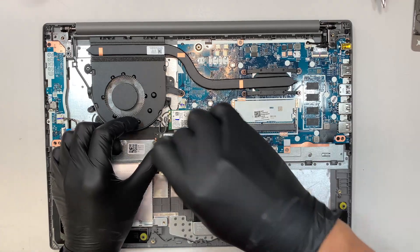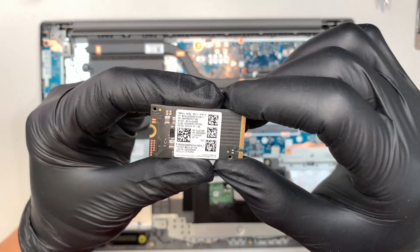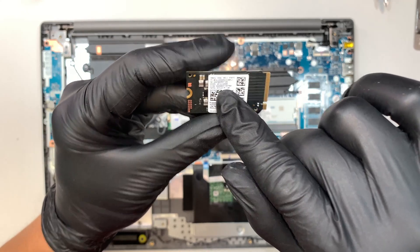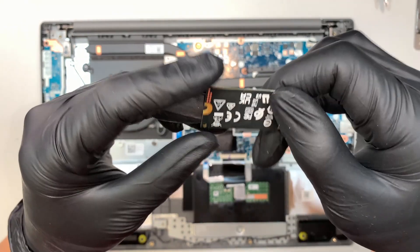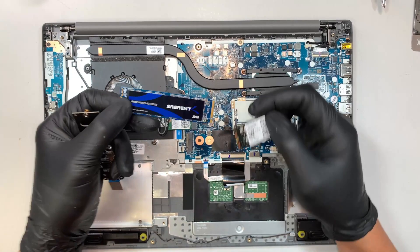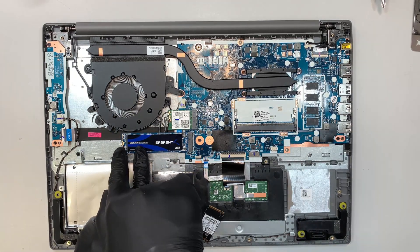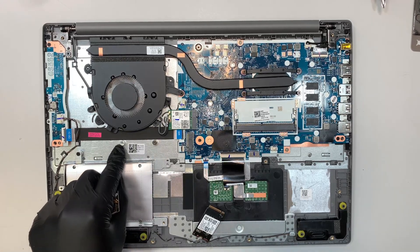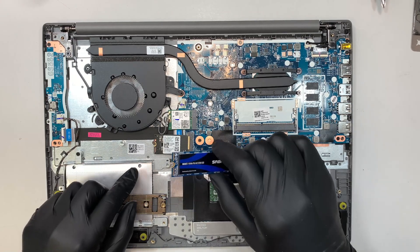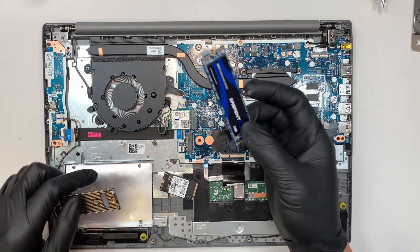Let's go ahead and remove the M.2 drive. This M.2 drive is the one that stores all your information — your pictures, music, everything is stored here. The capacity of this one is 256 gigabytes. If you feel that's not enough room, you can upgrade to a larger M.2 drive. This is the full-size M.2 slot; however, you see that bracket — you have to move that screw to the back if you buy the full version. If you buy the shorter version, you stay with the screw where it is. I'll link them in the description below — you can find them on Amazon as well.